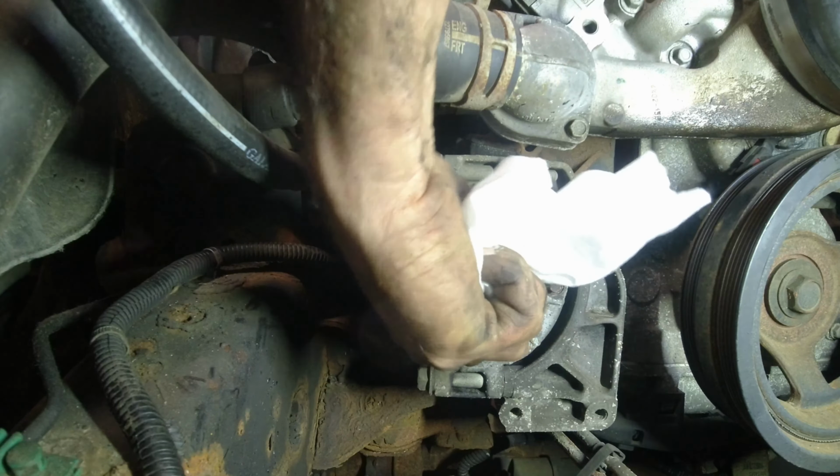On the back of it, there's like a little pin here. Now you know that that wire was here. If you look right here, this goes on, it should fit. It should lock on, the wire's up here. All right, same thing with the new one. Here's your little pin, your dowel. That's gonna go on here. She's a little tight. Locks right on. Alright, put the C-clip on.